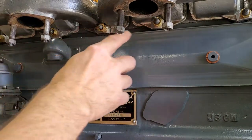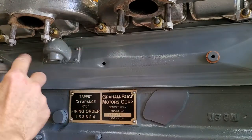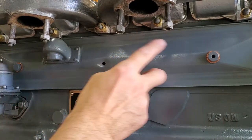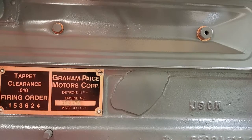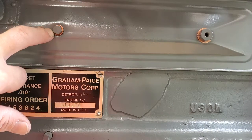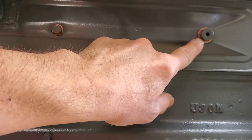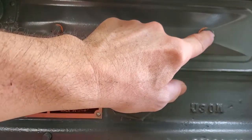When looking underneath your manifold assemblies, you'll notice we have Graham-style keepers all the way along the bottom and you have brass nuts. All the nuts must be brass. The brass nuts will not come undone through the heating and cooling cycles on the engine — you cannot use anything but brass nuts here. The little center bolt also has a copper washer; always remember that it's necessary for sealing. The front bolt has a hole in it because we have to put the air duct on the side of the engine next.